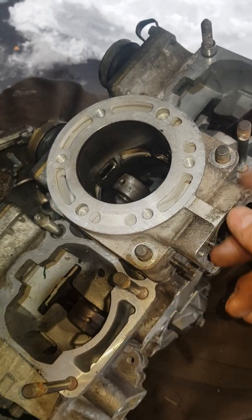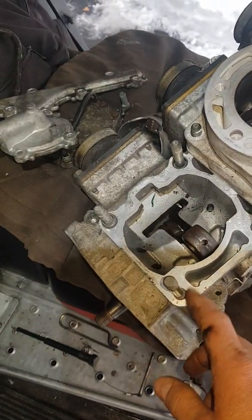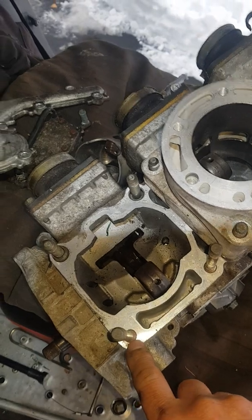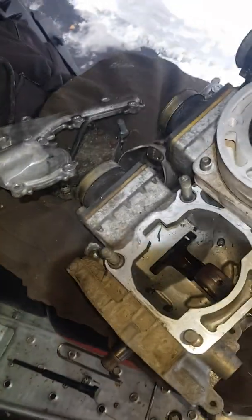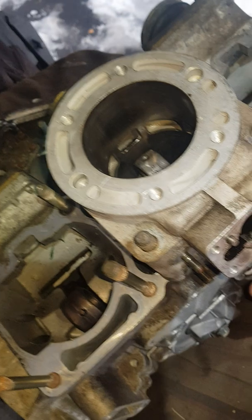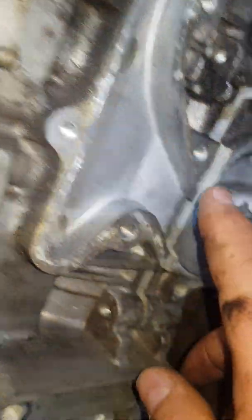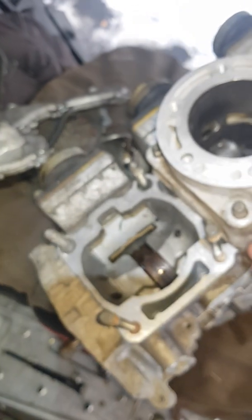So loosen these — they're 14 millimeter. It might be easier just to do one at a time. One of these is designed to come out from here. Take all four of these bolts off here, and then you've got your exhaust manifold. You should have already sprayed PB Blaster on these, and some of those are a little hard to get to. I usually get in there with a 10 millimeter ratchet to get these off. Once you get this, the manifold is all one piece — get that off.